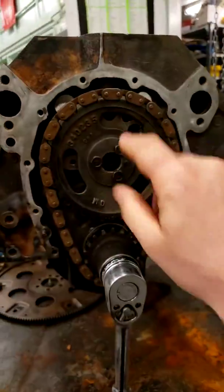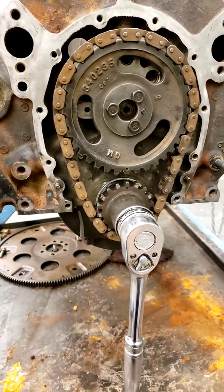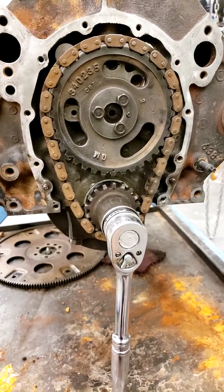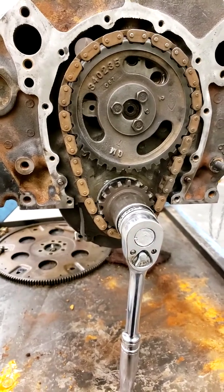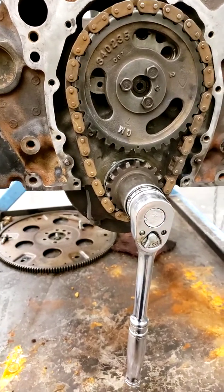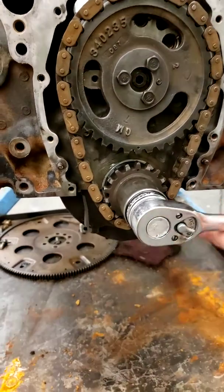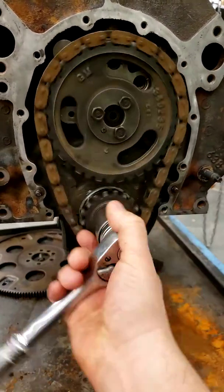If I put that gear on and have this pointing over here, I'm going to be opening up number 1 intake when it's on number 3 or something, right? And the engine just won't even run, okay? And then you'll get fuel going through everywhere, intake valves open at the wrong spots, spark happening and lighting it up at the wrong time, and you get backfiring and all sorts of things, okay? So very, very important to time that crankshaft and camshaft together, okay?